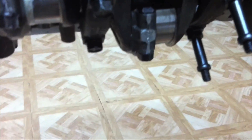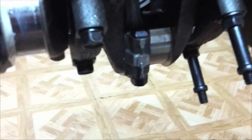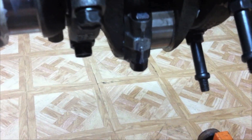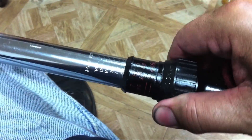As mentioned with the main bearings: any time you torque a bolt down, grab a Sharpie and mark it so you know it's been torqued — no second-guessing yourself. Also, remember that whenever you're done using a torque wrench, unlock the handle and twist it back to zero. That keeps you from messing up the calibration and keeps the spring and internal parts working properly.